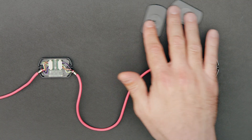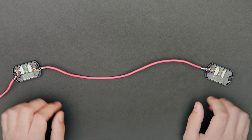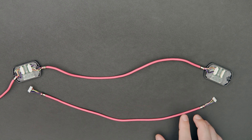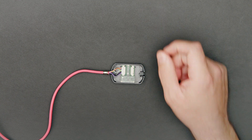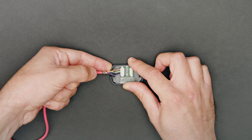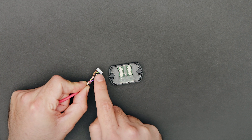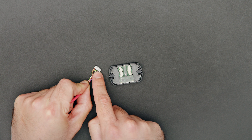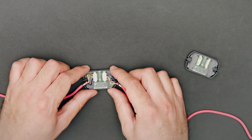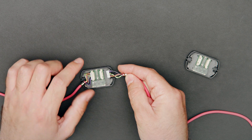We don't need the sensor tool for this next part, so we can put it aside. To figure out which cable size or length to use, stretch out the two sensors to give you the full cable length and then match that to the appropriate replacement cable. Here's the one we're going to use for this repair. In this case, the header pins are facing up, so we'll maintain this orientation for the entire process. To remove the cable, put your index finger on the sensor and then pull the cable while you firmly push against the sensor. The cable should just pop right out. You'll notice that the pins inside are facing up — this is the correct orientation.